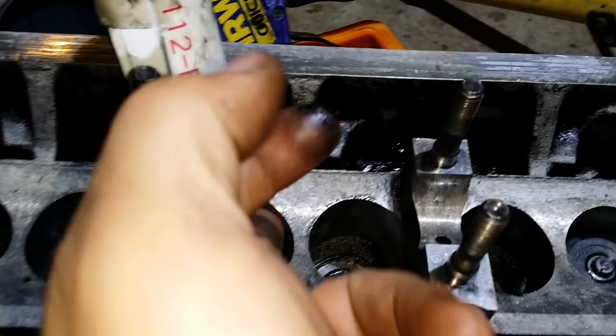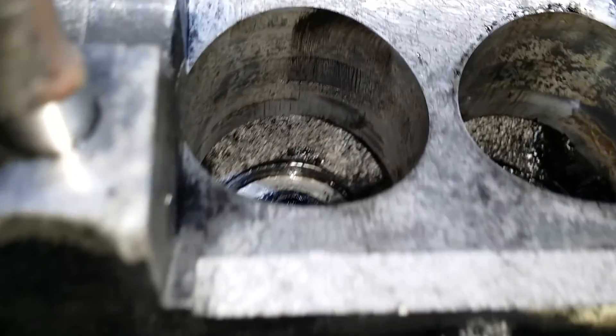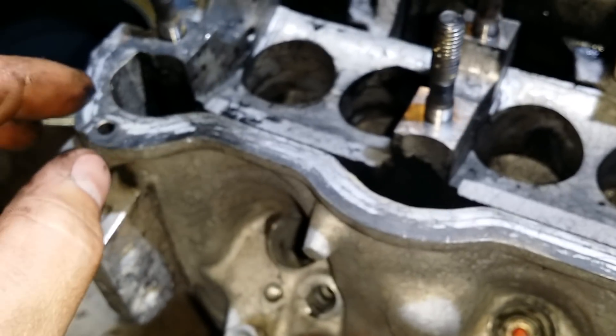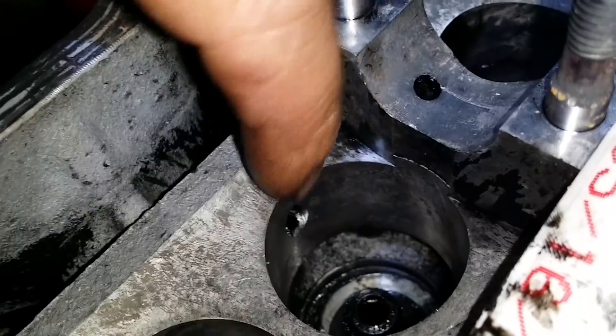At the same time it damaged one of these right here — it's damaged over there. The reason it caused that, I'm assuming, is the thick oil which got contaminated with the waste vegetable oil must have clogged one of these right here. This is a port for the oil that lubricates the pusher.